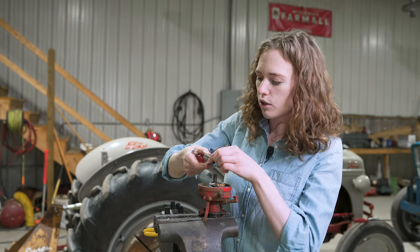Next you'll see the points. This little strap that comes out of there is extremely fragile, so work really gently — you need to pry it off the prong. It's crucial and fragile, so just ever so slightly bend it out of the way. Then use your screwdriver to loosen the points — there are just two screws holding them on. I did take this distributor out of my tractor so you can see what's going on, but you can leave your distributor in the tractor and access these parts with it in. It's a little tight on the 8N but more exposed on Jubilee and newer tractors, so leave it in there.